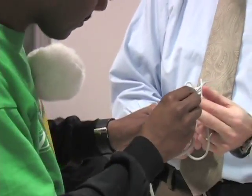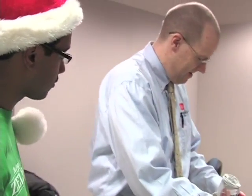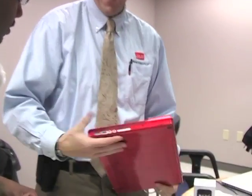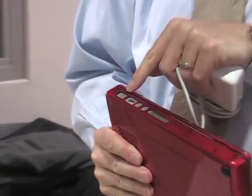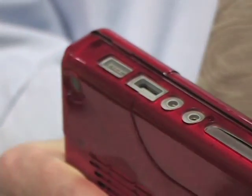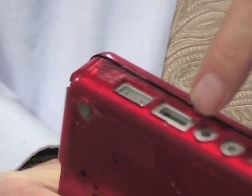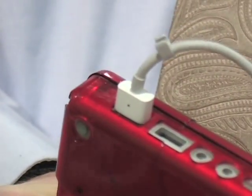The other thing is, look at that, Mario. What's that the exact same size of? Can you guess? Look at the MagSafe. Look at the MagSafe port on your unit. Guess what gets caught right in the MagSafe port? A used staple or a new staple. It'll get stuck on this, and then go in there, and if metal bridges those ports, you'll short it out.